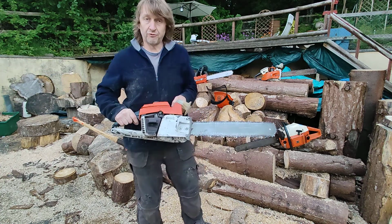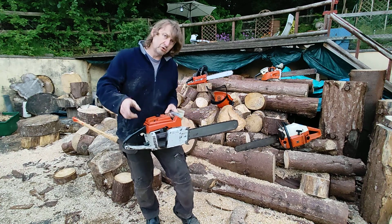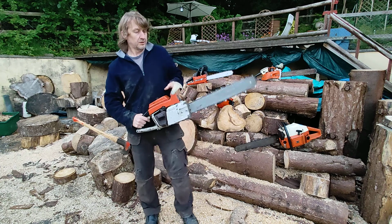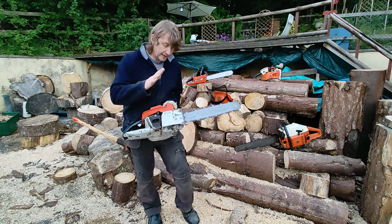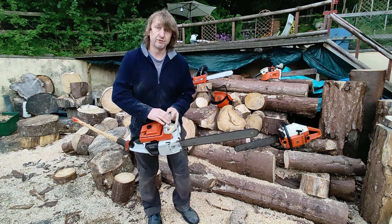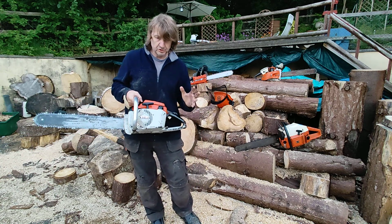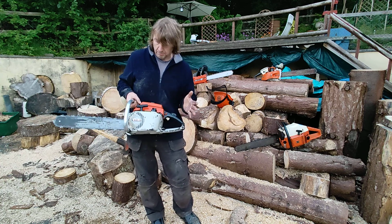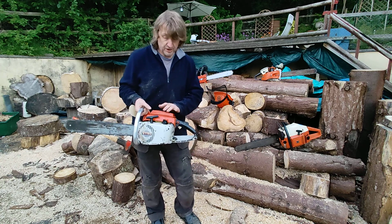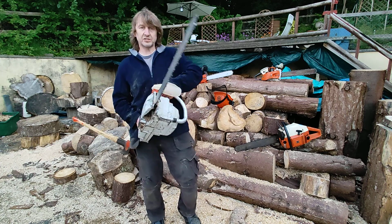Stihl 041 AV, mid 60s saw, just impeccable running, long, lazy stroked engine, gorgeous machine, and pieces for the workshop as well. And so, in case this one is of any interest to anybody, this girl has a brand new correct size 4.5mm pull cord, has all correct Stihl friction washers, correct fuel pickup, new correct Bosch plug, new vacuum line, fuel line, had a correct Tillotson carburetor kit for her, and doesn't obviously require anything else. Chain life on it is excellent.